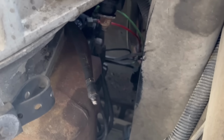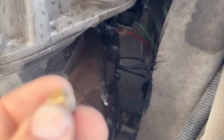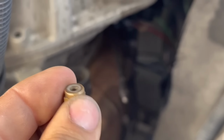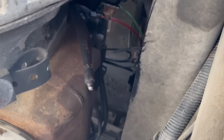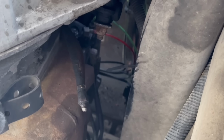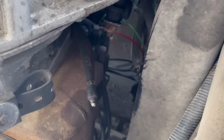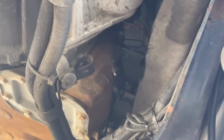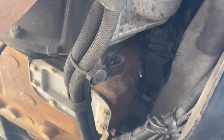And you see that red line, right? Well, it had a compression fitting on it. It's a little 3/8, and right behind the nut, the line had a crack in it. I could not find it for the life of me. I sprayed it down, I did everything. Couldn't get to it. And the biggest problem with it is right here between the frame rail and the transmission.